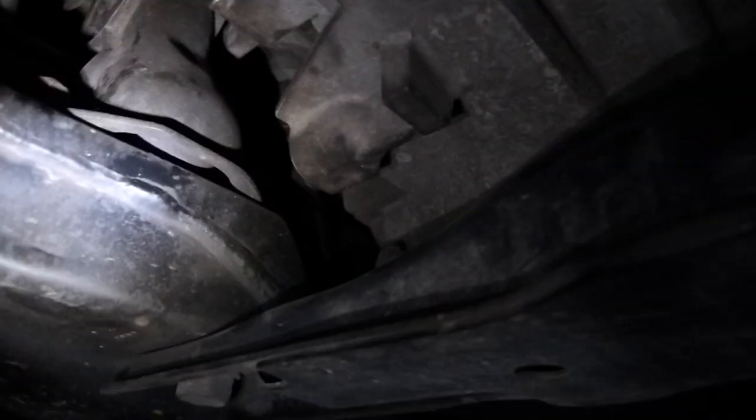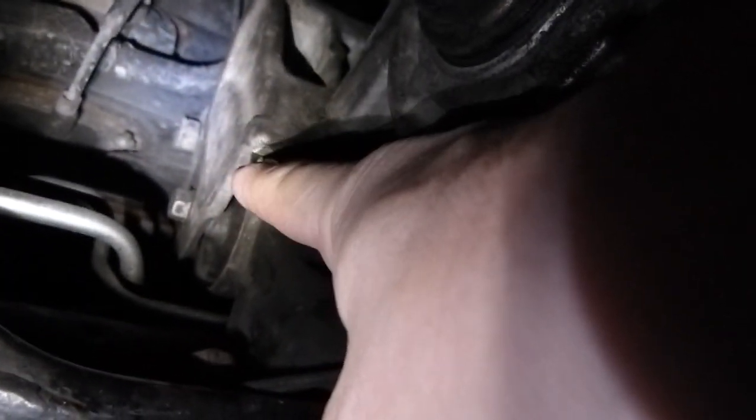You're looking at this engine mount here in front of the camera — that makes this sound. In it, there is this part of this mounting bracket here. There is a rubber in the center of it, there's a mounting bolt there, and what's loose is this bolt here that I'm undoing — just a little bit, just raising it so you can look at the head of it. There, that would be the head of the bolt.